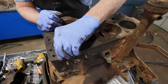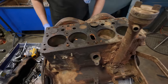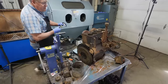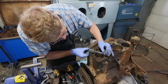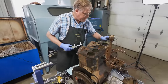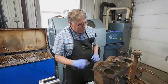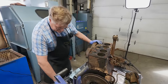Some ridge in there, not as much as you sometimes see. I don't see any markings on the pistons. Let me go get a caliper and just measure the bore size to see if this has ever been done before. That appears to be about 3-1/8 inches, which I believe is standard bore size. So maybe no one has ever touched this motor before. Man, that would be great. I don't know if I've ever seen one that was standard size yet — I recall many more of these that were already oversized than standard. So let's keep going here.